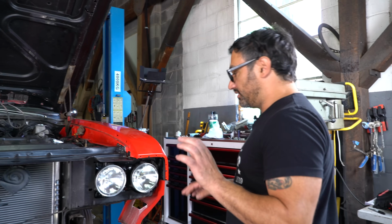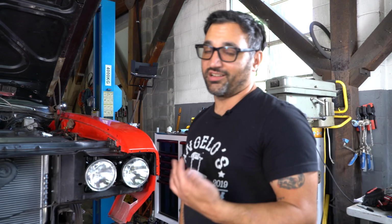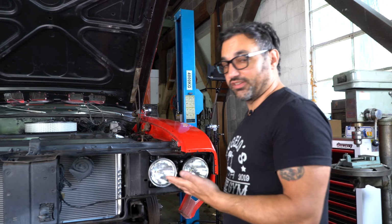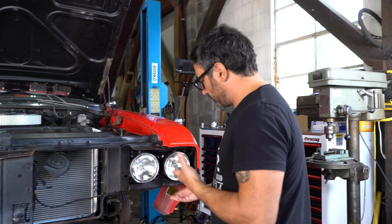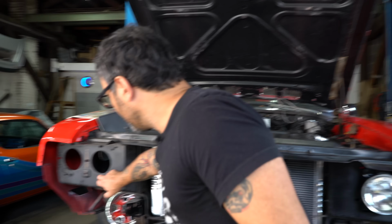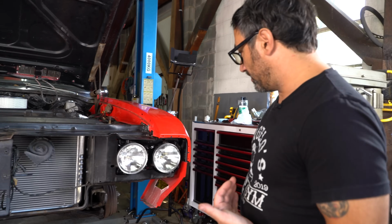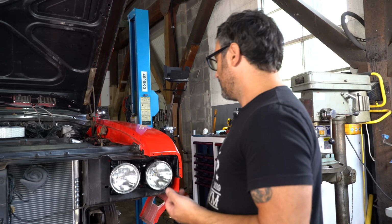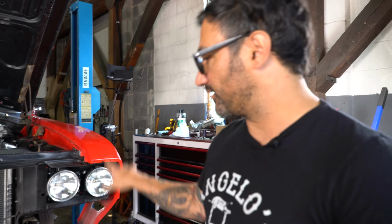Yeah. So the deal is this, to make these 70 headlights work with the 71 core support, and I don't know why anyone would do this unless you got thrown all these parts like we did. We're gonna just space everything out about a 1/4 inch, just to clear these raised pieces that are probably alignment pieces that don't do anything for us here. Then we gotta drill in our surrounds, and it might look ever so slightly wonky with them pushed forward, but I doubt you'll even notice it, to be honest. So we're gonna do it. We wanna get this thing up and on the road. Zach's gonna get cracking on that stuff, putting on spacers, drilling everything in.